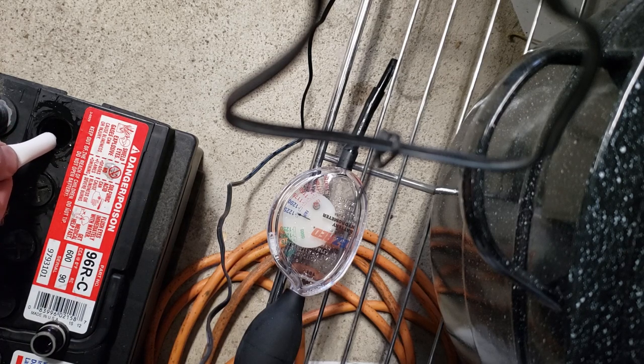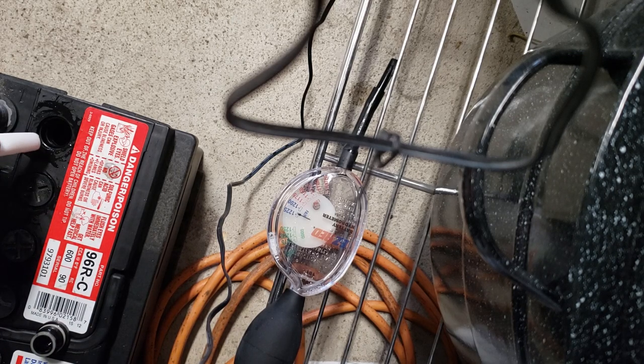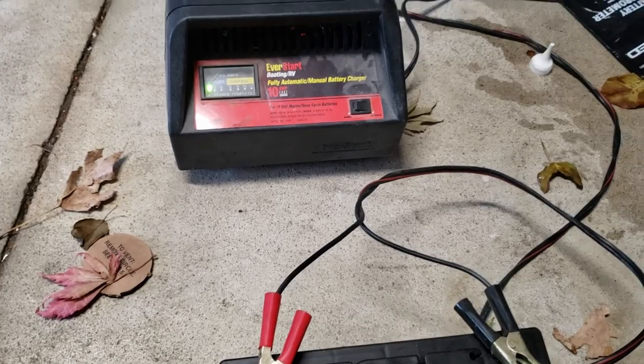Now I'm just going to pinch off the hose. Now it's hard to see if the water is touching the plastic. But when the water gets an impression on it, basically like a dimple in the water, that's when you know the plastic is touching the acid. So just that little bit was enough to fill up that cell. I filled up the battery and cleaned it off.